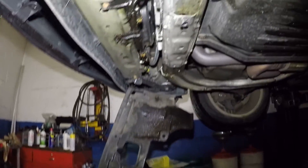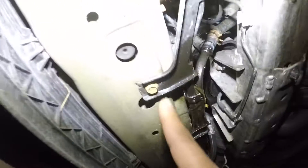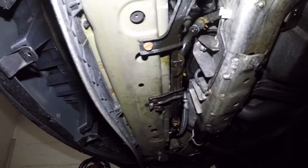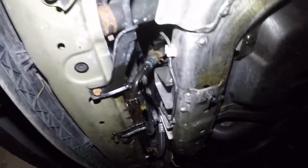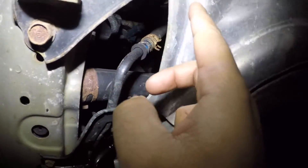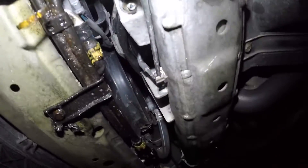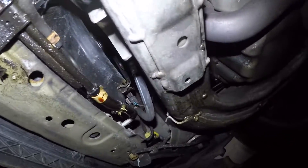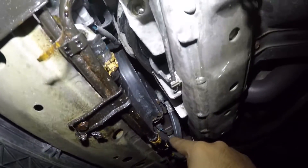Very simple procedure guys. Right down here, I want you to remove the cover. You need to take off this number 10 here, number 10 there. Take it easy — sometimes they break, but you don't want to heat it because there's a radiator right up below. I removed this little clamp right here, push that clamp off, and that pipe will come off. Take off this — I was not able to grab this one because it's up on top. What I did was I pushed it off from this end.